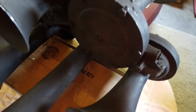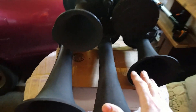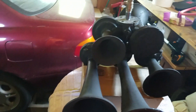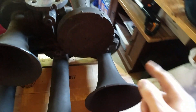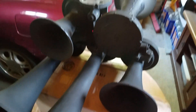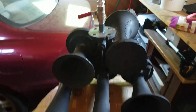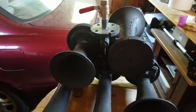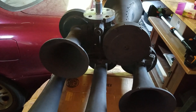She's still kind of dirty — I haven't done any cleaning. The only thing I did was put a new cushion ring and a new back diaphragm in the number three, because a lot of times people get a horn and they'll just test it before cleaning or they won't even open it up. But if there's an issue like that it can get a lot worse and start destroying a lot more stuff, especially if it's a front diaphragm that's broken — you're really going to start to destroy your nozzle and the horn's not going to sound very good anyway.